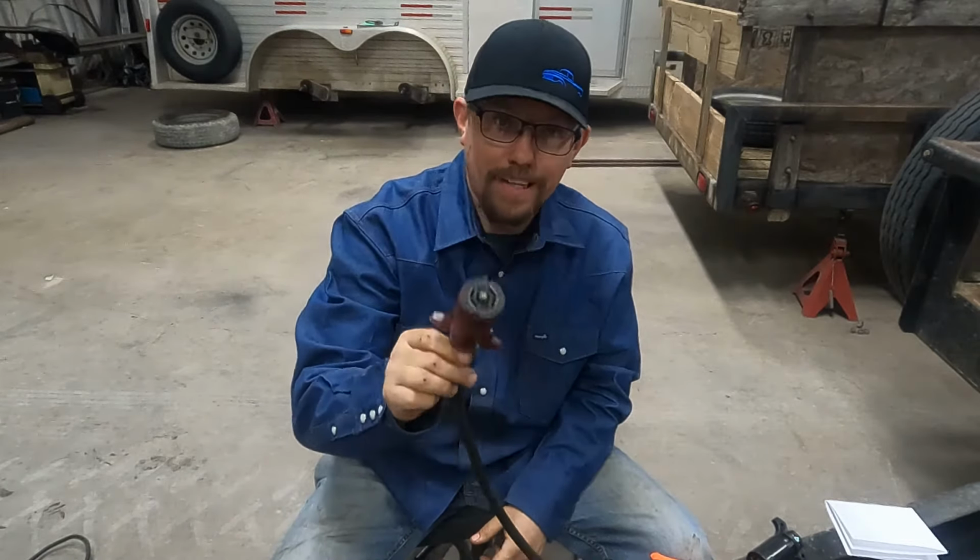So I can see here, it looks like the white wire is the ground. Let's try it one more time. There it goes. That's a hard spark. So the white wire is our ground. If you want to write that down on your piece of paper, white is ground. We can start everything else from there.